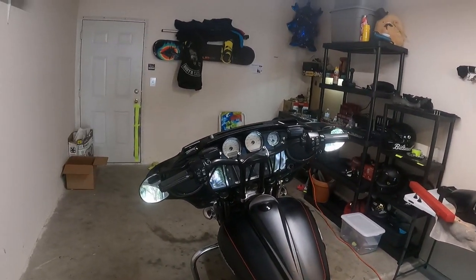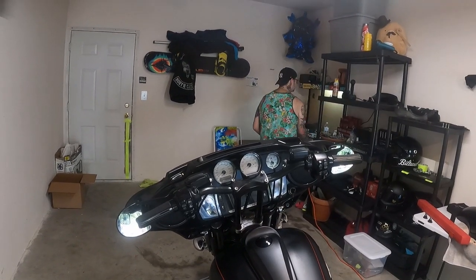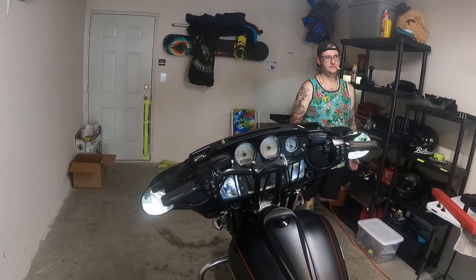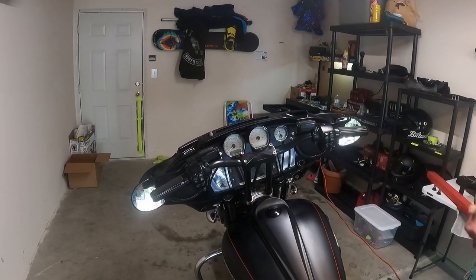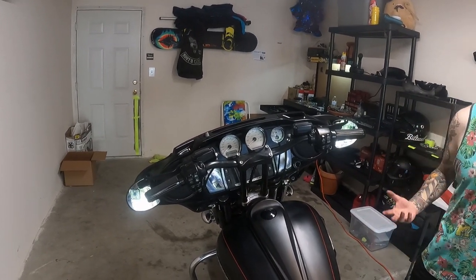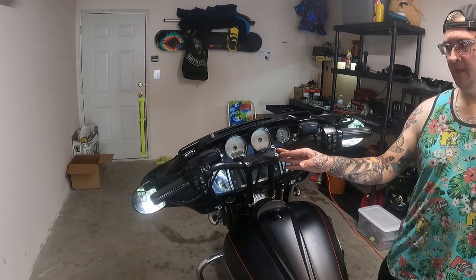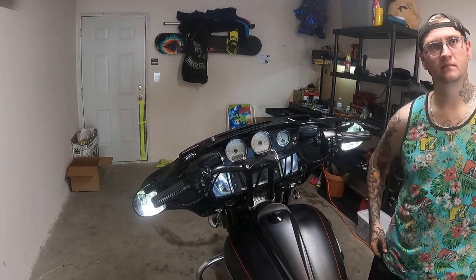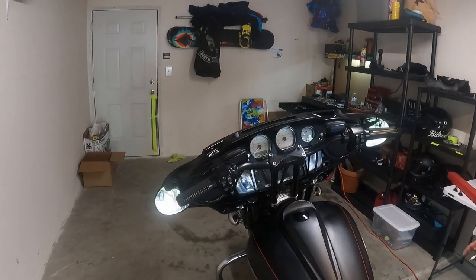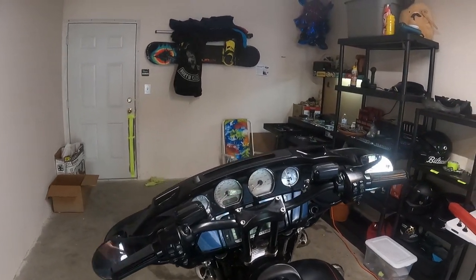It's pretty cool. So how much height do we have here technically? What's the overall? You got 1.5 inches on the plate. Yep. And then you got 10 inches on the risers. 10-inch risers. And then a 2.5 inch bar. Okay. So it's like a 12.5. It'd be 1.5 inches plus 10 is 11.5. So 14, plus 2.5. Yep. 14 inches. Okay. So 14 inches, basically. From there to here, I don't know how that equates to if you had apes.